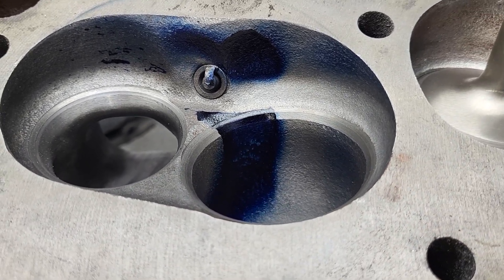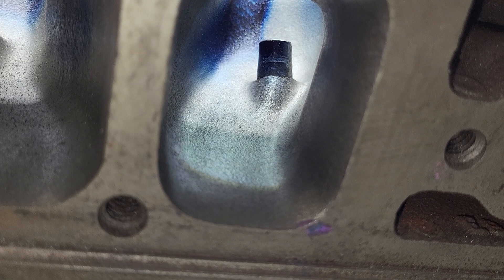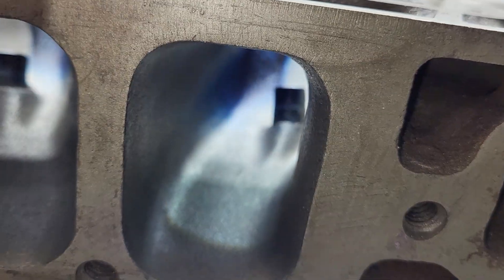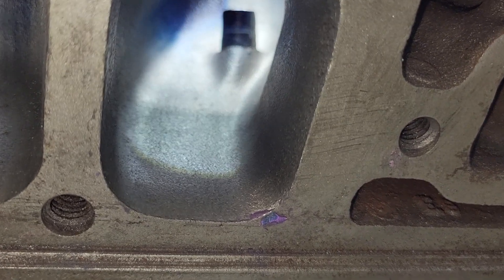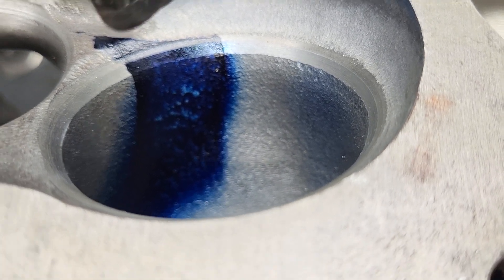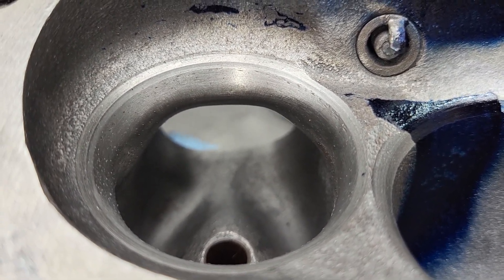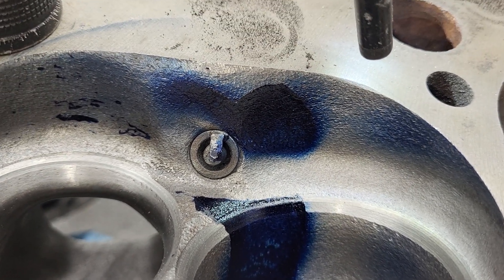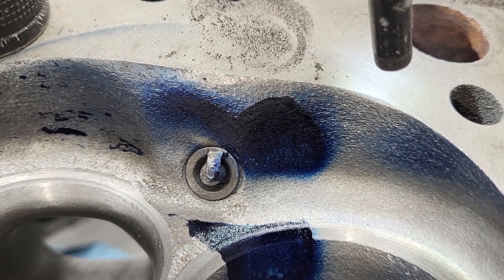Let's take a different look. You can see we've got a lot of blue on the left side of that port. The port was basically cleaned up - I took off the real rough aggressive burr texture because I wanted to do a lighter burr texture, and I took the lumps and bumps out, which is really 90s porting - that's all I did to it. I worked on shrinking up the valve job a little bit. The exhaust is not nearly as wide; it has a radius that goes right to the seat. The chamber got cleaned up but didn't get a fueling notch or anything like that.